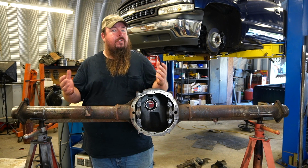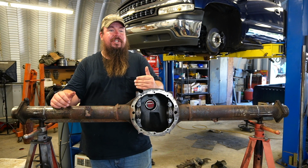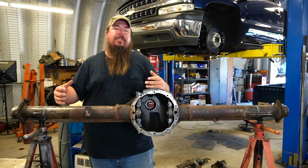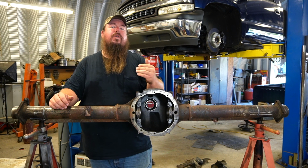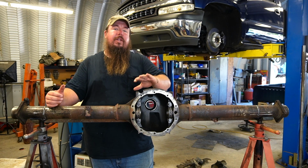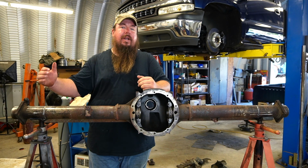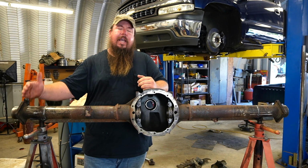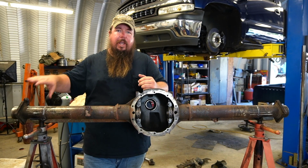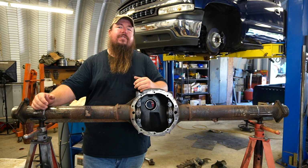because they're not designed for street driving, and they even explicitly say in their instructions they're made for drag racing. The way the seals and stuff are, the way the bearings are, they're just not made for a lot of long-term street use. So a lot of people don't run that style if they want to run on a street. I've seen people even go as far as putting like a 9-inch housing end on their axles so they can run a regular style wheel bearing on it, set up like your tapered bearings for like a 9-inch or something like that.